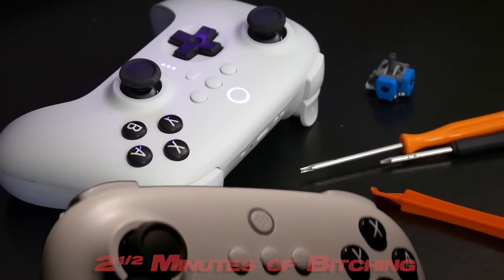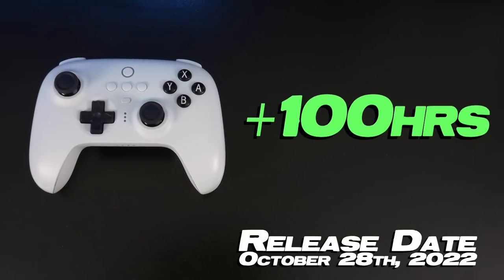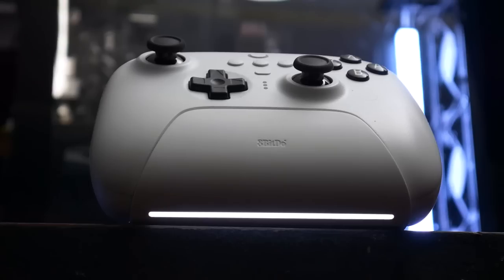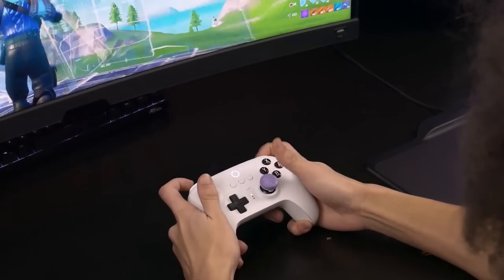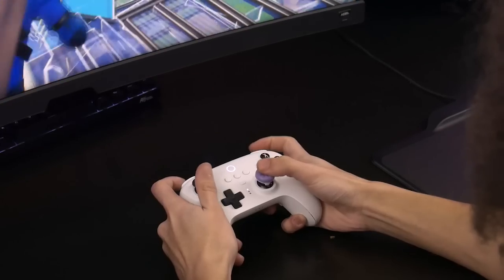One advantage of my slow upload schedule is I get a lot of time with devices — I've logged around 100 to 120 hours on the 8BitDo Ultimate. The controller is relatively new so I may revisit reliability later. In the time I've had it, I've only charged it three times. The battery is only 1,000mAh but claims up to 22-hour life. Warning: critically low battery can cause stick drift or double-clicking buttons — charge it before assuming it's broken.